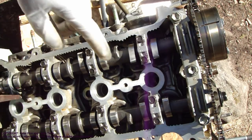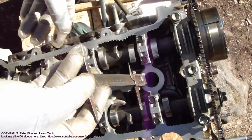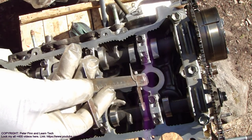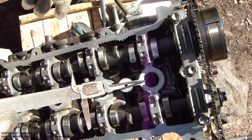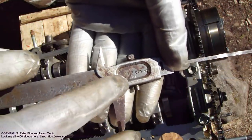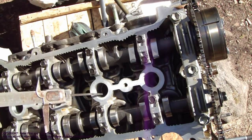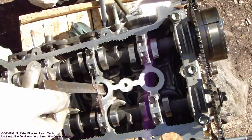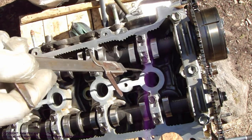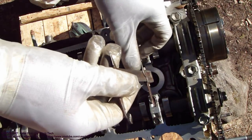More sophisticated and better ways than this fluke way is that we use some metric, like I have this special metric or some stick, and then I measure this amount. When I check in here, it hits this piston and gives an amount of almost 12 centimeters deep in here to this piston. And then when I compare this second piston hole, this area is so deep that my measurement is too short. Okay, and then we know that this piston is up, and this measurement data is actually really accurate.